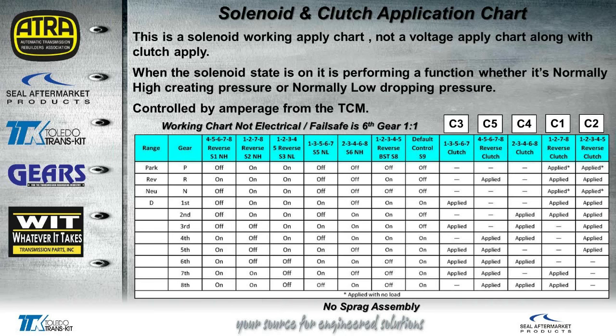One of the other things that surprised me when I started getting involved with this transmission was no sprag assembly — there is no sprag in this transmission. When the ZF6 came out and the 6R60 used in the Ford, they did not have sprags in those, and we always seemed to have a lot of problems with downshift complaints, especially on the 2-1. When the 6L80 came out at the same time, they always had a sprag in the GM even though it was the same technology, and we didn't seem to have as many complaints on the coast out. So it's a little surprising to see they're not going to have one in this transmission.